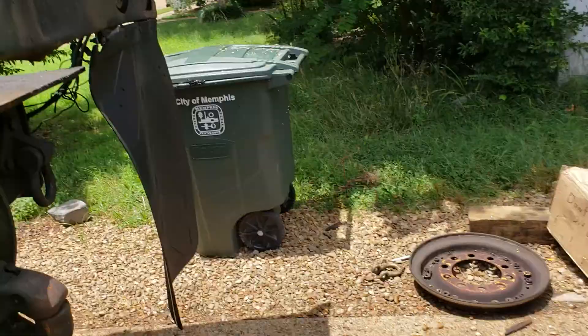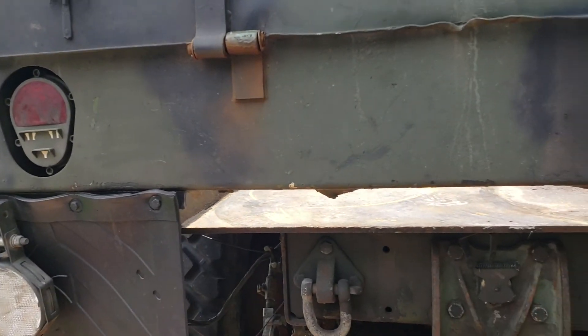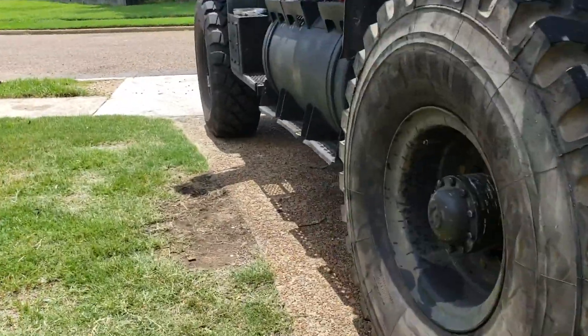Stoplight switch is on — you got brake light here. That one's actually undone at the moment, I was checking something else. But you can see you can bypass your switch like that, and it shows you if you have brake lights or not.